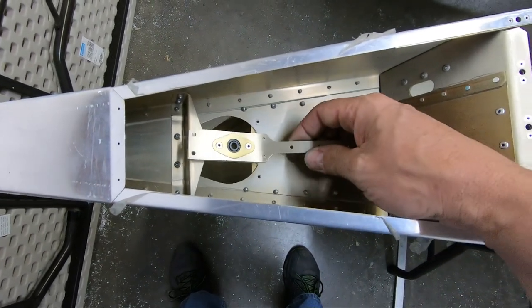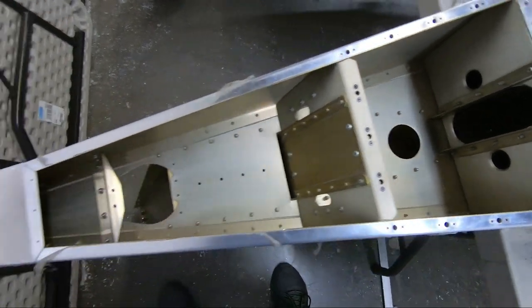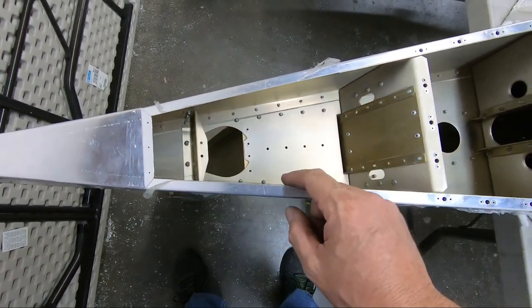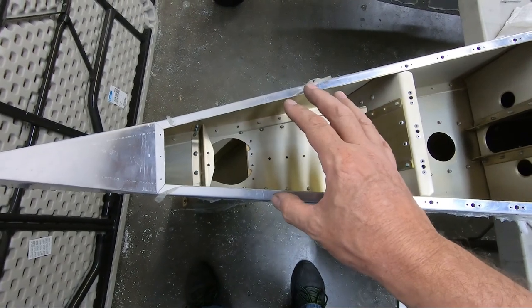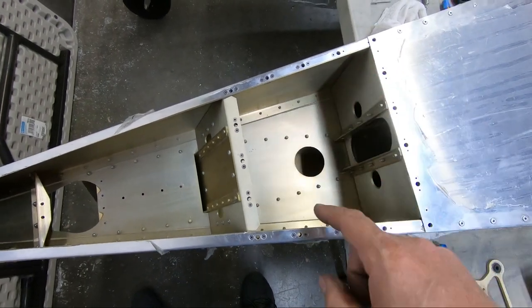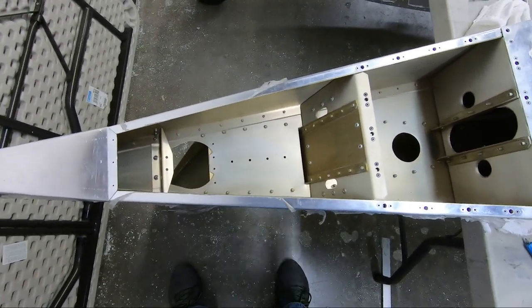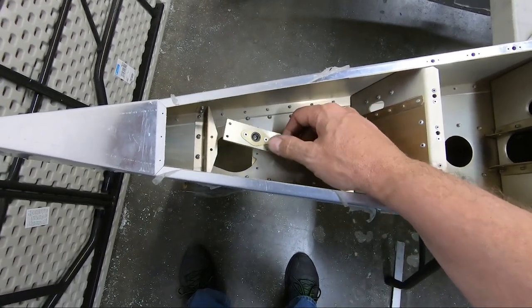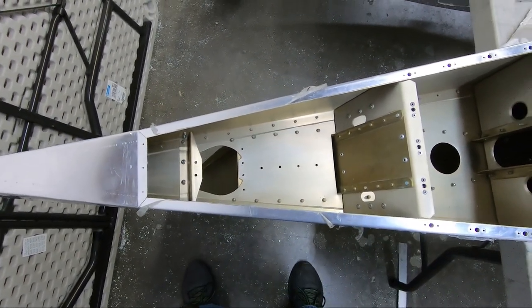Once that's done, we're really finished with what I wanted to do here, other than finishing this bell crank — and I won't have those materials anyway. The only other thing I might do is get the clear cover that's supposed to go over the top positioned and get all the holes drilled. One thing I'm a little concerned about is that plate is supposed to be clear Lexan, like an inspection hole. There's another aluminum cover that has a center window for inspections, but this one is supposed to be pop riveted into place, which makes it difficult to get in here to get the rudder off or even lubricate this fitting. I'm not sure I want to pop rivet that into place.